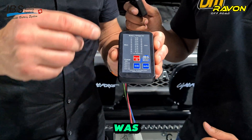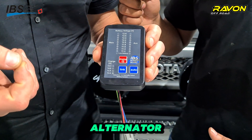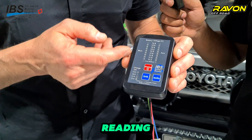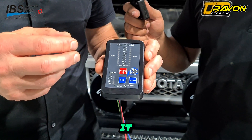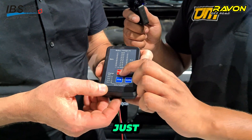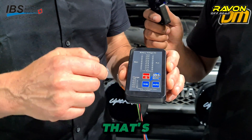The main issue in Australia was not being able to detect that the alternator was dying. In this system, there is a charge indication that tells you at all times whether the alternator is properly charging — and as soon as the engine is running, you always have the alternator reading displayed. The second missing feature was information about the charge level of the batteries. For that, there is a very simple reading with colored yellow, green, and red LEDs that everyone can properly read even without a manual. You push display and see exactly what is happening to your batteries.